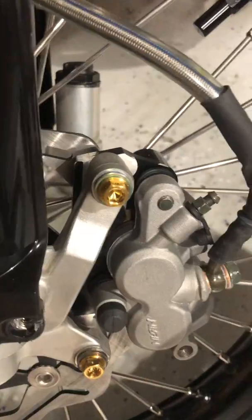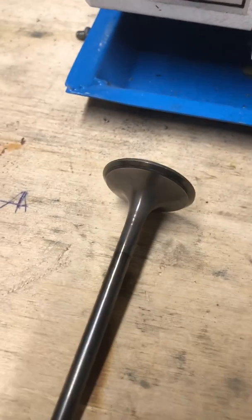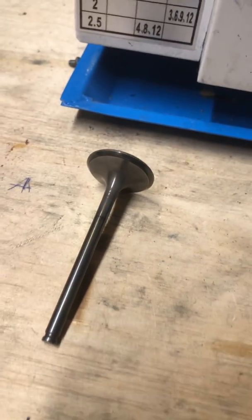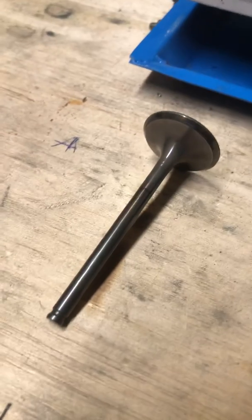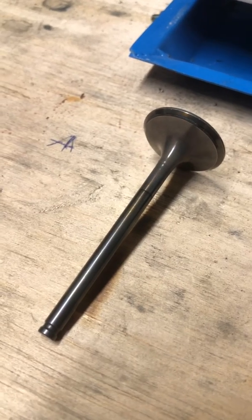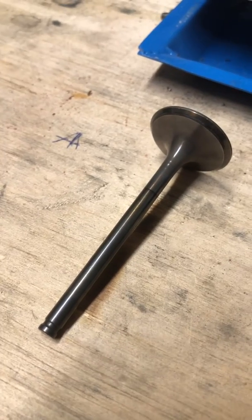It'll handle that all day long — like my brake caliper bolts, these are all titanium. You don't have to torque those to death. But titanium has its limitations. The Kawasaki valves they use are a two-piece valve. You can see that line right there — that's where they fuse the valve together, and that's where they snap. Period. That's your biggest problem with Kawasaki, and I'm assuming other brands too, because titanium valves are just a bad idea in the long run.